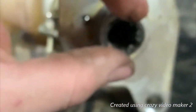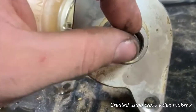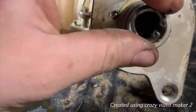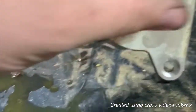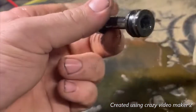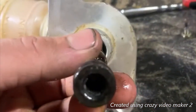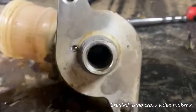So this little circlip just sits right here. It's got grease over it — you have to wipe the grease off. So you'll take that out. Then this end, I guess this is the rod that sticks into it — it comes off your brake. It'll come out like this, shoved in there, and the spring will come out. That's all I've got out so far.